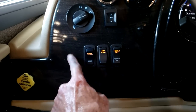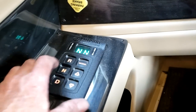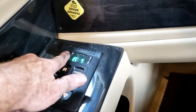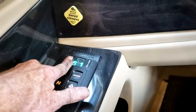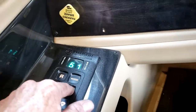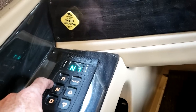This little red light is just an indicator that your jacks are down. Transmission control is pretty straightforward — N is neutral. In D you have six forward gears and it automatically shifts from first all the way to sixth, with sixth being overdrive. If you're towing something or don't want overdrive, select five and it won't shift past five. My habit is to hit neutral, set the park brake, then turn the engine off — that way you don't forget to do it all.